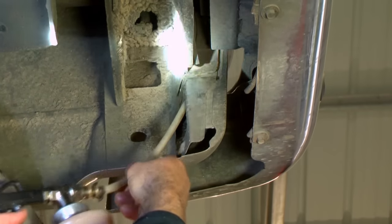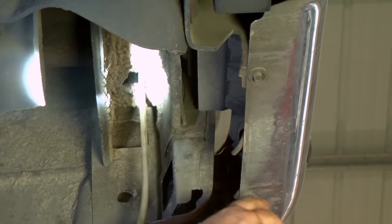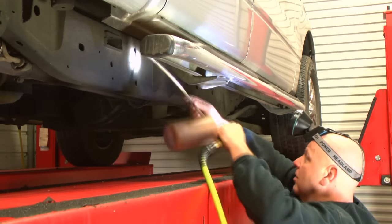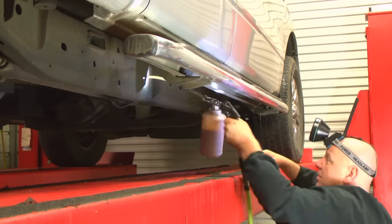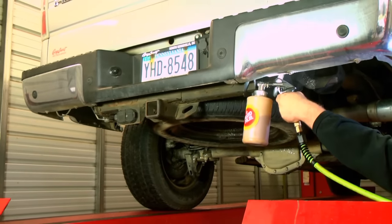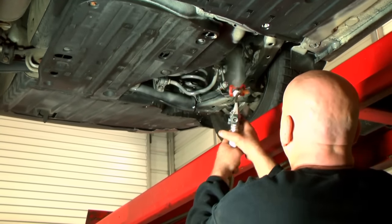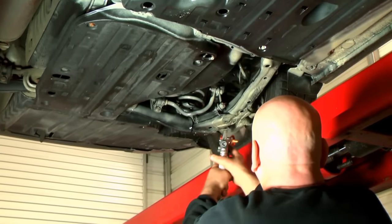Moving components and spare tires should be coated as well. Work from one end of the vehicle to the other, ensuring all frame holes are filled. Once filling all the voids, apply a coating to the structural frame and suspension components.